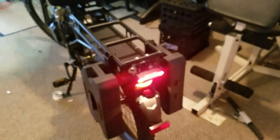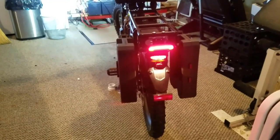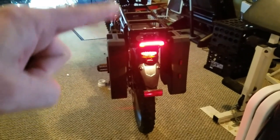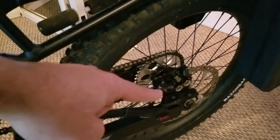Here's where things got more complicated — features we felt should be factory additions. You'll need a brake lamp assembly to get your moped registered. The challenge on the Motoped is there are no switches in the disc brake to tie off of. Standard motorcycles have a hydraulic pressure switch that's easy to wire a brake light into, but there are no switches here, which is a really big challenge when trying to get the bike registered and ready for inspection.